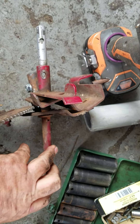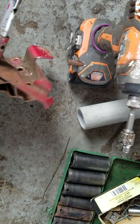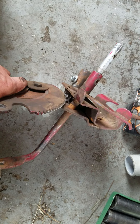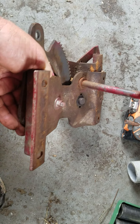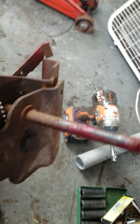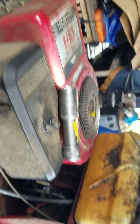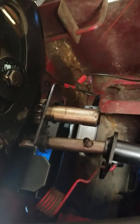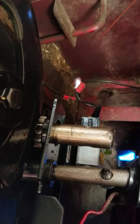You could probably hammer it out of there, but that's hard to do when it's in the mower. If you can get the shaft out, do so. If you can't, unplug the switch — it has a little plug — and try to turn it inside the mower and get it out to the side. You'll have to take that whole front end off where it connects. The new one comes out easily — undo that bolt and the shaft slides right out. You can put it underneath here between the belt and the foot pad and feed it up in there. Make sure you remember which way the washers were on it. There is a little spacer in there — you can see it. Reconnect your switch.